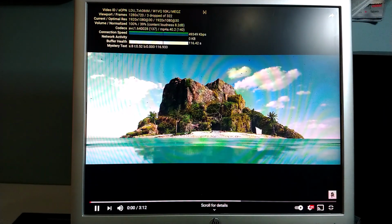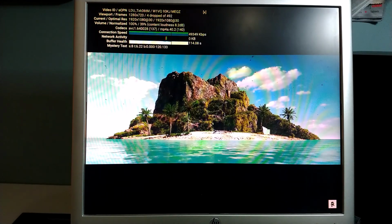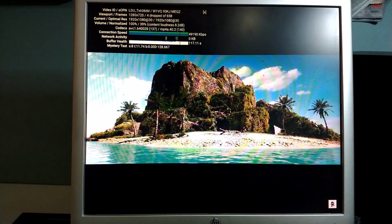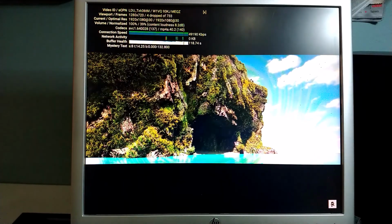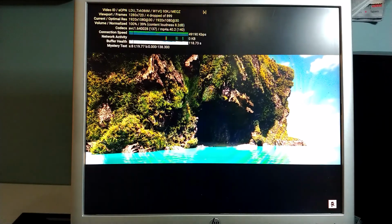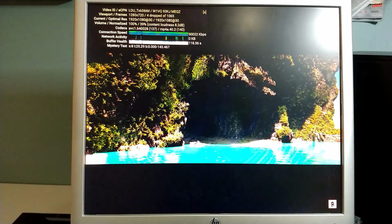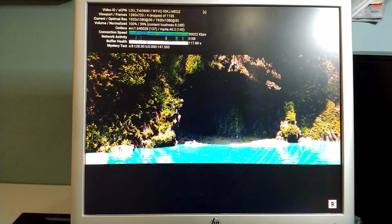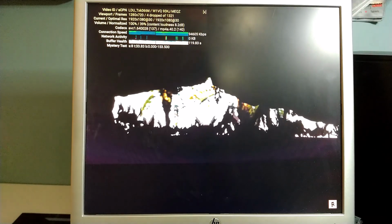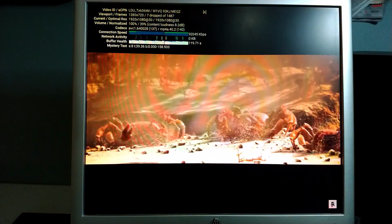But hitting the play button here and taking a look at our quality, picture is clear, crisp. There's no hitching or jumping or stuttering. From a frame drops perspective, we are like in the less than 1% frame drops range, which is exactly where I would expect us to be given this. Without that h264ify, we'd probably have to drop down to 720p, maybe even lower because of that Intel GMA integrated graphics card. But overall, this is good. This is, I would say, a good experience for someone who's maybe used to using a cheap tablet they got when they opened up a bank account.